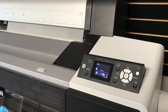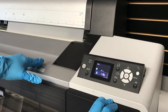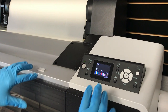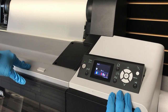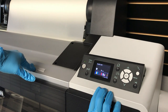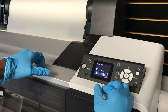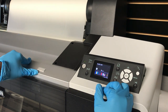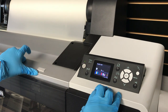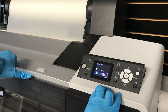I have to assume you're about to run your daily maintenance, so you would normally have a roll of film loaded. First, you want to release the platen so you can roll the media up on itself, because we're going to take a piece of paper towel along the track to clean the printhead surface. You don't want that film in the way, and once we enter the mode I'm about to show you, that won't be the time to handle those things.